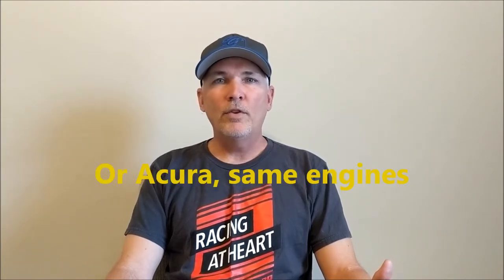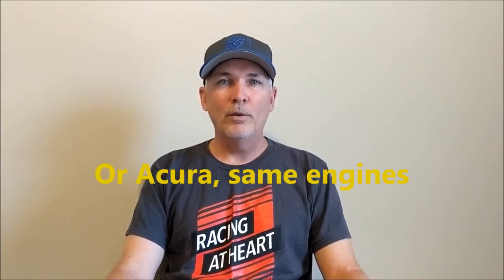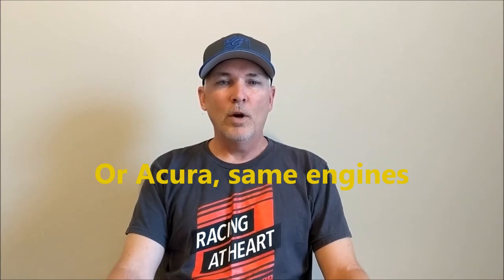I'm working on my wife's car in the garage, putting a timing belt on a 2010 Acura TSX with the 3.5 V6 engine. It's time for a timing belt replacement — they're supposed to be replaced about every 100,000 miles. The toughest part of the job on these cars is the crankshaft bolt. Hondas are notorious for that bolt being very difficult to break loose. You'll get to watch me go through the whole process, lots of fails, and then finally success.